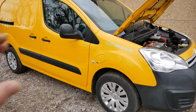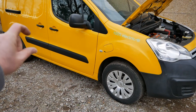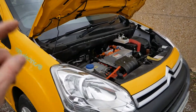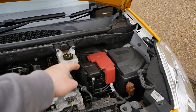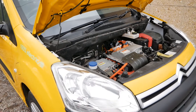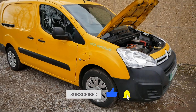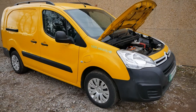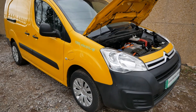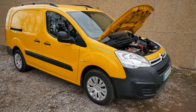I hope that helps, and that you don't fall into the trap that a lot of people do — when their electric vehicle isn't working they assume the worst, thinking it's the traction battery underneath that's flat, or that it's a fault with the vehicle. But in 99% of cases it's quite simply that your 12 volt battery has gone flat, and that's no different to any combustion engine vehicle. If you found this video useful please click the thumbs up, do subscribe, and there's a playlist link in the description for more videos on the Peugeot Partner or Citroen Berlingo.